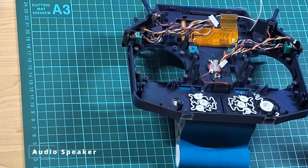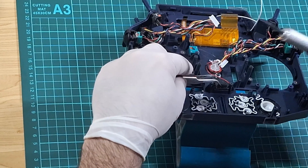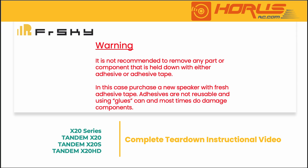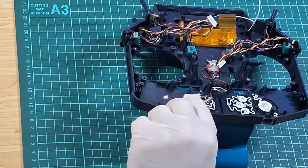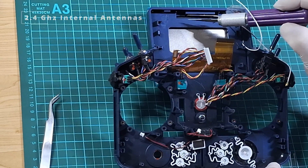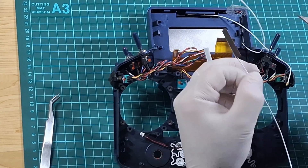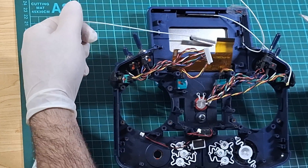Now we move on to removing the audio speaker — that's held down by adhesive, something I don't generally recommend. Anything held down by adhesive, I'd always buy a new part because once you use the adhesive, you can never re-stick it a second or third time. If you need to remove it, just wedge it off with a scalpel. If you look at the top and the right hand side of the LCD recess, you will see where the 2.4 GHz coaxial antennas sit — they're held down by adhesive as well. I don't recommend you take them off, but if you do, just wedge them off with the scalpel. The only time I'd recommend you remove those antennas is if they're faulty.